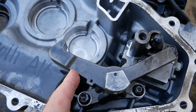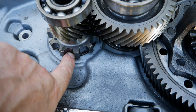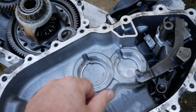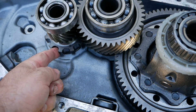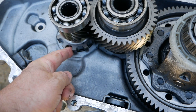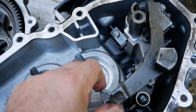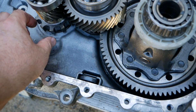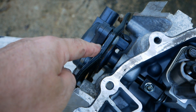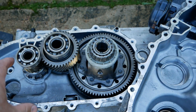This lever goes up and engages or locks into the drive gear, so your transmission is then locked and can't move. The issue is if you engage park first - locking the transmission - and then apply the handbrake or parking brake secondly, the weight of the vehicle is locked in on that gear set. When you come to release park it puts additional strain on the park actuator because the vehicle's weight is on the gear set. Over time you can burn out this park actuator, and on the majority of gearboxes you cannot buy this part separately - you have to buy a whole new reduction gearbox.